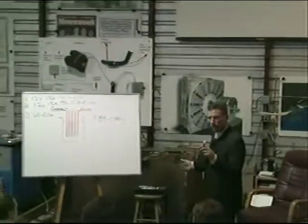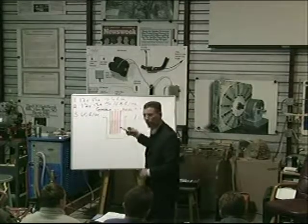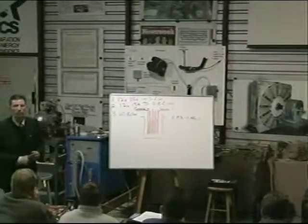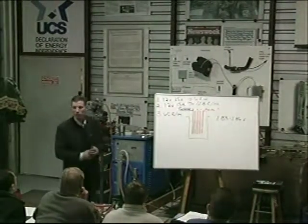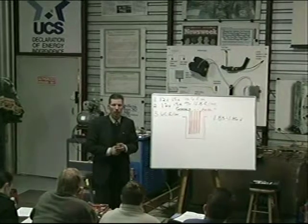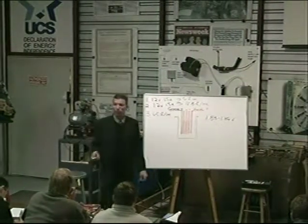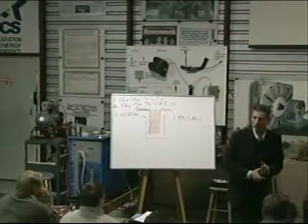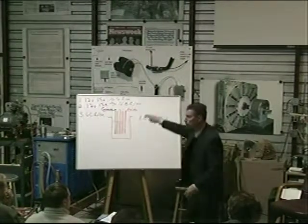When you first turn the car on, apply voltage to the cell, even if the electrolyte is spot on, we're targeting 15 amps. But when you first turn it on, you may only be drawing 8 amps. Sometimes it's gone down as low as 6 amps. But don't start dumping more electrolyte in trying to get your 15 amps. Let it run for 20 minutes or a half hour and come back and check, and you might be at 16 or 16 and a half amps. You might have to actually pull some out and just put distilled water back in to bring the amperage down.